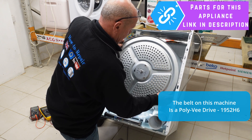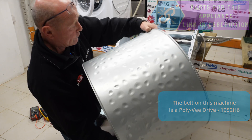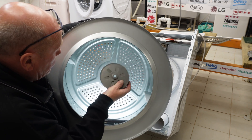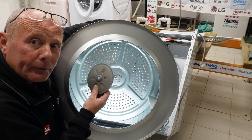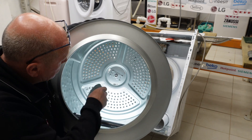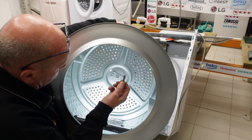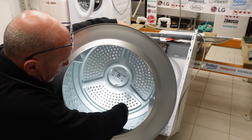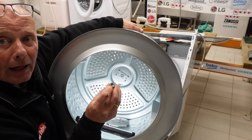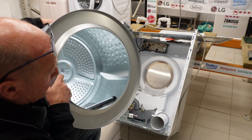To get the drum out, just move it to one side on the other panel, and then the drum will come out. Here's the actual plastic cover — I imagine they sell hundreds of these because of the amount of people that break them thinking it comes off from the front rather than the rear of the machine. Four screws in here will release the bearing assembly, and then you've got the notorious bolt you can't easily access. They have put a hole in here, but let me bring it to the camera — you can see how shallow that allen key holder is. This is why it's a two-man job.